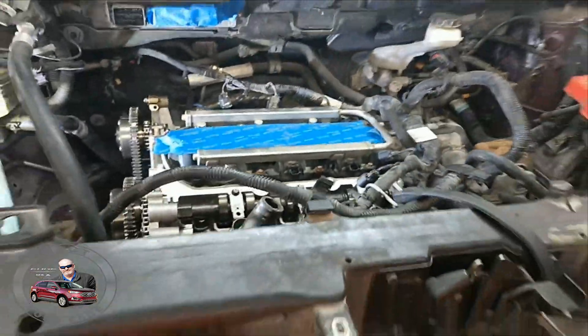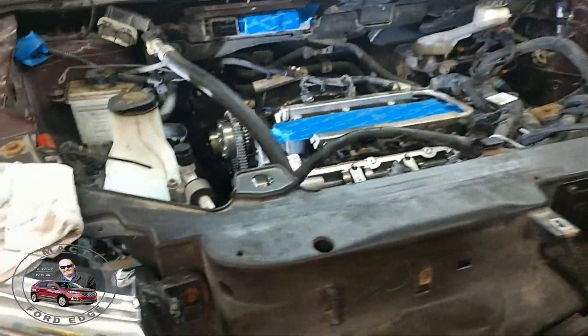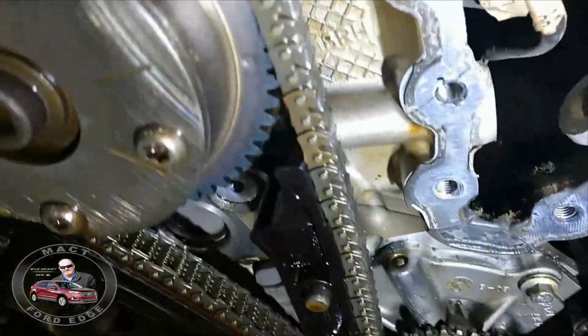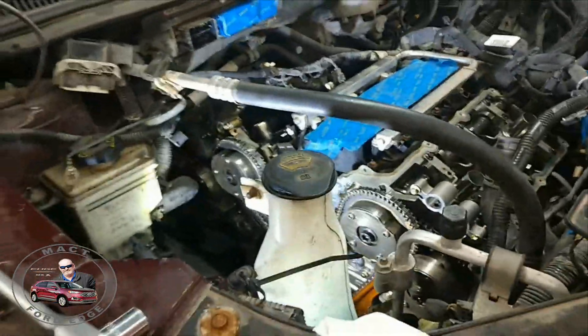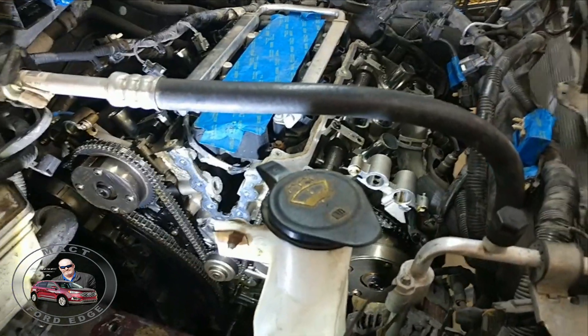That's it, folks — this is how it's all working out. We got the engine mounts and everything out. Now we're just working on getting the timing figured out, because we got to get those timing marks lined up. We got one right there, but we got to get the other one where it needs to be. Right now we just got to keep turning everything until we figure it out. We have two timing chain links up high on the phaser right now, and we got to find the other link going down. Thanks for watching, folks, and we'll keep you updated more on what's going on and how we're coming along with this job.